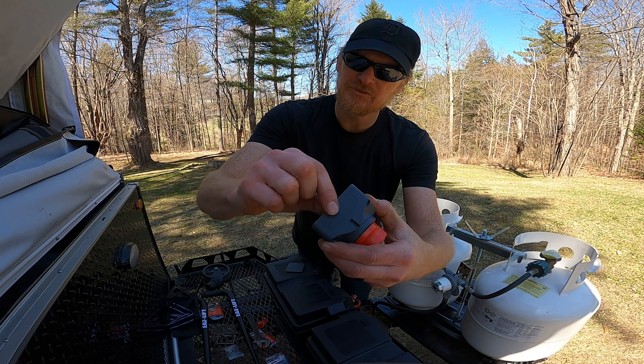I've returned. I made a decision on where to mount this thing — I'm going to put it right on the front of the box, in front of the positive terminal. The positive cables are going to mount on this side, and the positive terminal coming off the switch is going to go up through the vent hole on the cover, and then straight onto the terminal itself. That'll be clean, easy to reach, and well protected. I'm going to break off the tabs and wire it up.